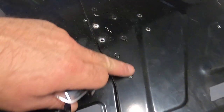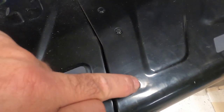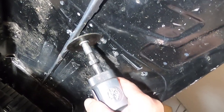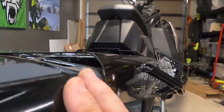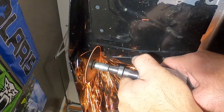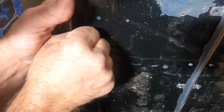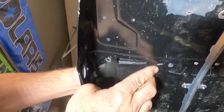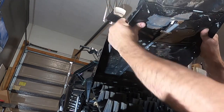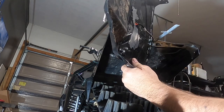Now that we've got all the pop rivets out, we need to get these other rivets out on the top of the tunnel that hold the rest of the tunnel extension on. These are a little bit harder to get out — sometimes you can drill a little pilot hole right in the center and then drill the top out. Since we're cutting this part off anyway, if you mess up the top it doesn't matter. Another easy way: come underneath with a cutoff wheel, grind off where it comes through the bottom of the tunnel, and that allows you to separate the two pieces. So we'll just grind these all off and then pop it apart just like that.